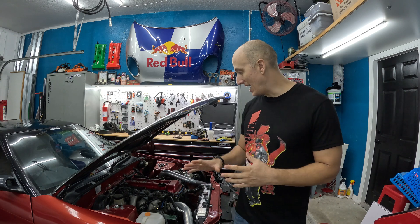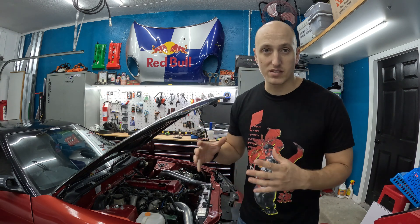All I own is old cars that have problems — especially on turbocharged cars, and especially once you start modifying them with intercoolers, cold air intakes, anything that messes with the vacuum system. Just from being older, those rubber lines deteriorate, especially if they've been neglected. Underneath the hood is just a harsh environment: it heats up, cools down, and this stuff doesn't last forever.